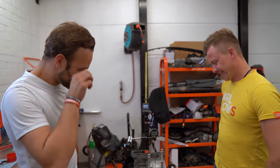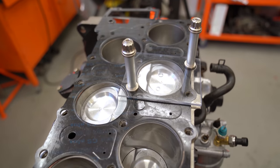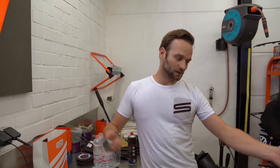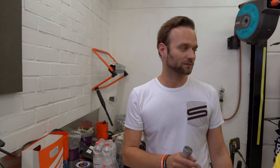I'll write it down. TDC is determined, so we can remove our setup now. Now we need to somehow determine how much oil we're putting in. The whole measuring process is always done with the highest viscosity oil possible, because it seals itself better. It flows more slowly, but stays in position longer as it should be. Since neither the piston rings nor our improvised plexiglass plate are 100% sealed, we estimate roughly 100 milliliters. We do this best by going to the Motul website, where there's a nice data sheet for every oil. From there you can easily get the density at 20°C. We measured approximately 20°C - maybe 18 or 22 degrees, but it'll work.